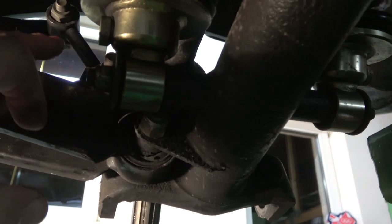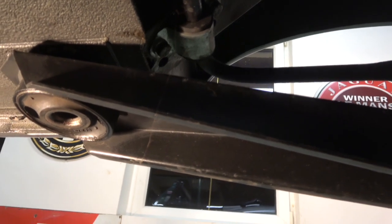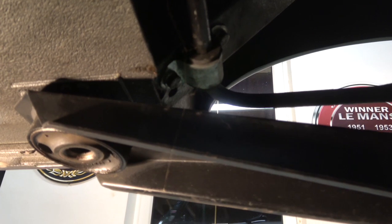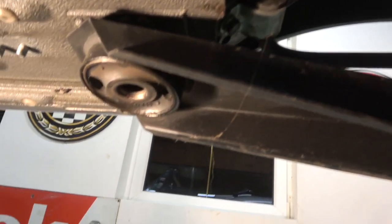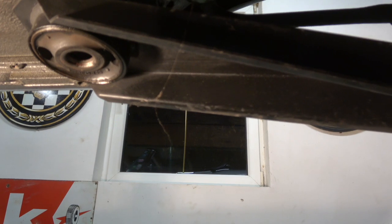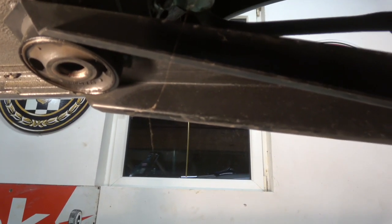This one's out. I've got to just take this bolt out here now and take off this anti-roll bar, and then I'll pull this one down and I'll show you the technique I used to get it off. But they really are very, very tight. I was surprised just how tight these things were. So yeah, but I'll take that one off in the next video. So there'll be a part 2, probably a part 3, because I've got to buy the spares and put it back together. So on that note,